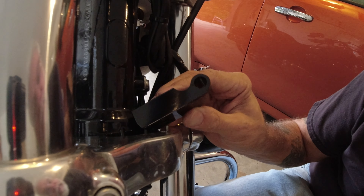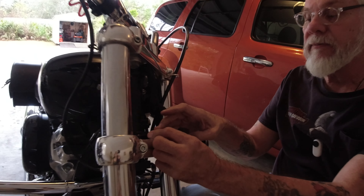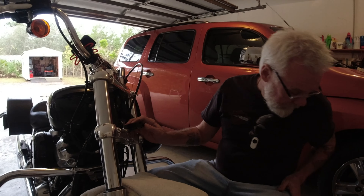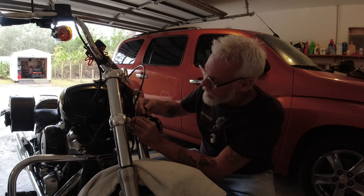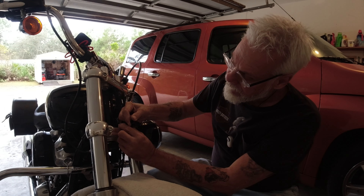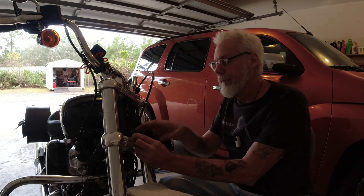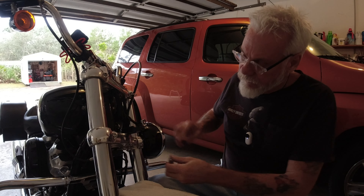There are two different positions you can put it in — you can bring it back a little bit or bring it forward a little bit. I'm thinking we're going to need the more extended version, so that's where I'm going to put this block. If we have to go back and adjust it, we can. This is the long block, by the way — they sell a short block and a long block. I bought the long one because I heard it was the one recommended to use with this particular bike and fairing. It comes with some spacers — when you remount the headlight, you're going to need these spacers on either side in order to make it seat properly. So basically we're just putting this block back to replace the stock one with the extended one.